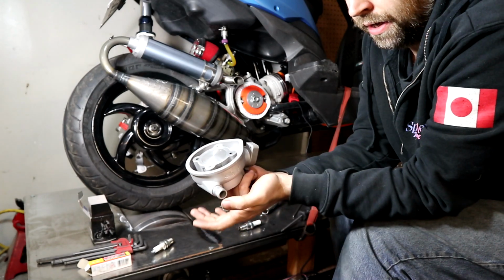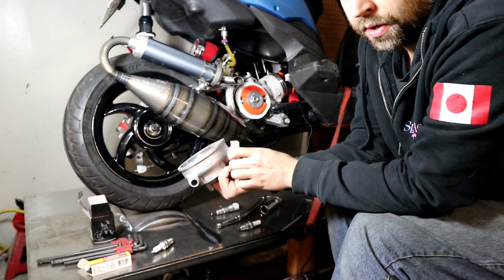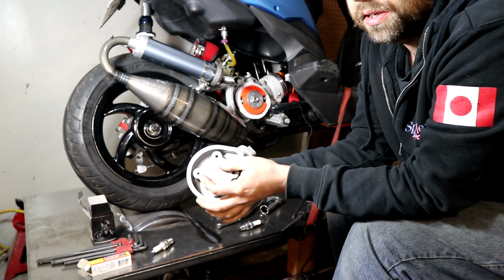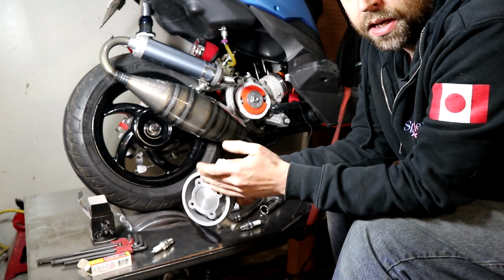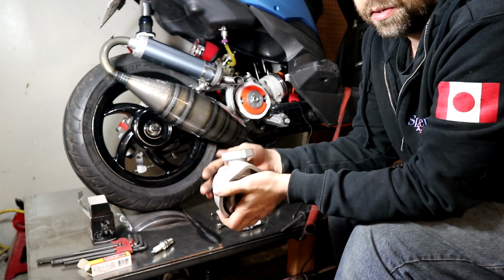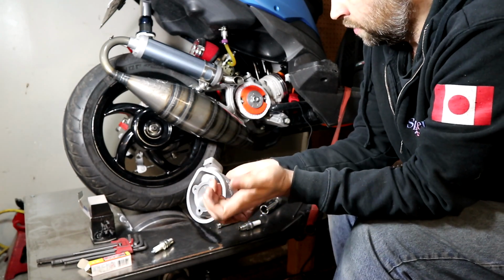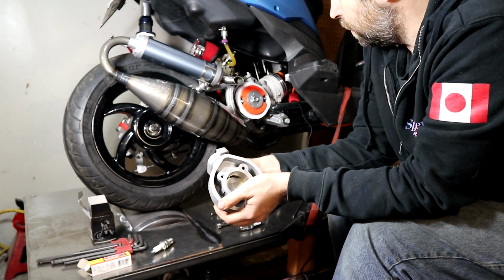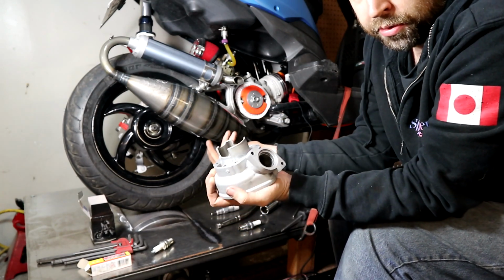For example, I have seen a few NSR 125 and 250 timing curves, Aprilia timing curves, and a lot of them usually are around 30 to start and then taper down to like 8 or 5 degrees at 12k or 14k or whatever they're spinning them to. That's just a ballpark. There's lots of factors that make timing different for everything. You can't just say, oh, it's this, because there are other factors in the motor that play into that. So a lot of the time it's something that you kind of have to play around with if you want to get peak horsepower for your setup.